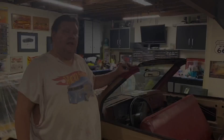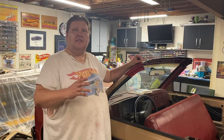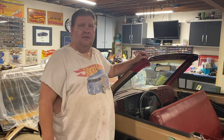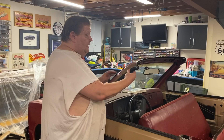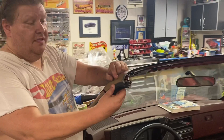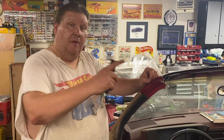Now that we've got our cuts done, we use the grinder to grind everything nice and smooth around the edges — the cab wall on the back, too, and the roof. About a half inch back, we want to take the paint off so the epoxy will stick. We also got the cut done on the door. What that does is: the door stays with the door, it opens up, and this top portion gets reattached right here — the kit gets molded right on top of it, so this part never opens. If water leaks in right here inside the door, there's a channel — water hits that channel and runs down instead of coming right through up here. Later when we put the kit on I'll show you exactly why we do this.